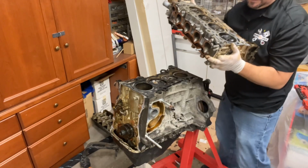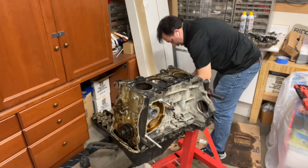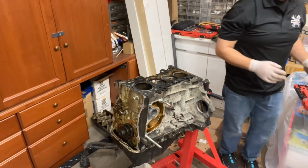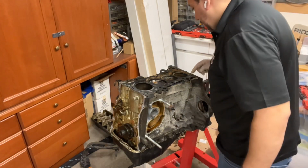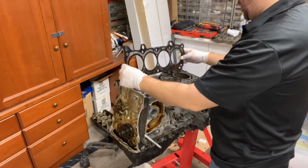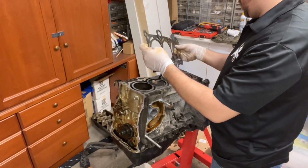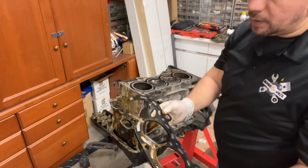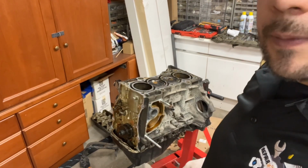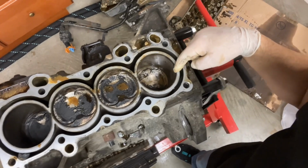All right. They're very wet, that's for sure. They are wet. And it's not just oil. Feel some water in there, so there was definitely water going into the engine. Oh, I see a lot of water there. So this was definitely because of water. It hydrolocked probably. Look at these. This is not clean oil. All right, here we can see some water in there.